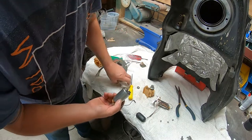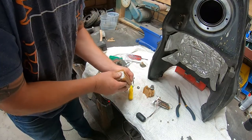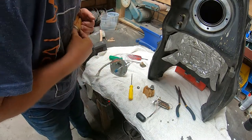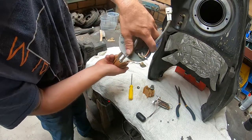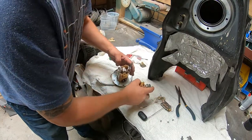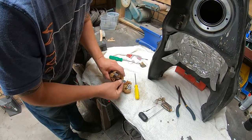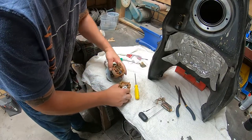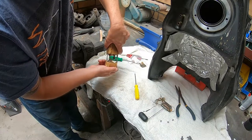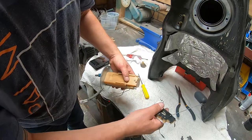So that's your motor and your fuel pump. The new filter just sits on the end like so — it's quite a tight fit. The pipe has got to get in beside the filter. Then it's just a matter of the reverse procedure. Don't forget to put your O-ring back on before reassembling.